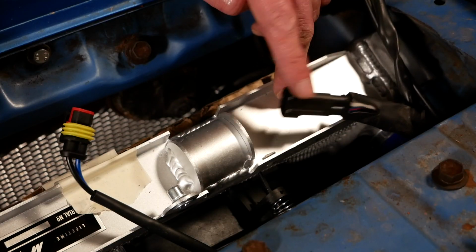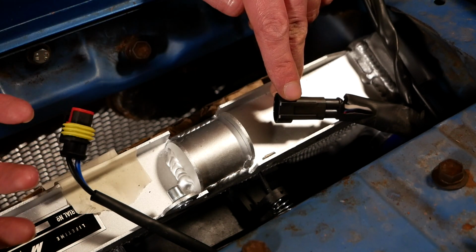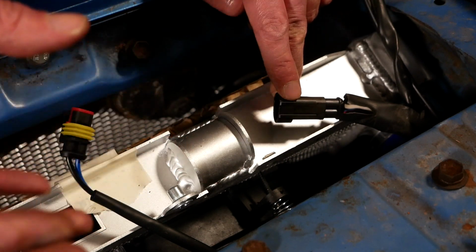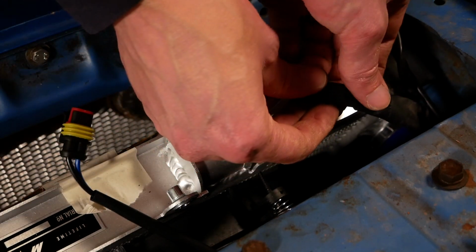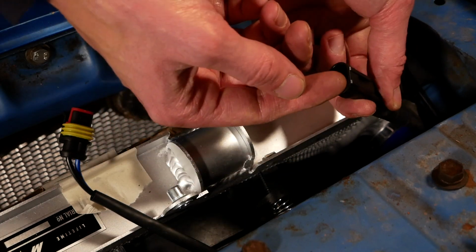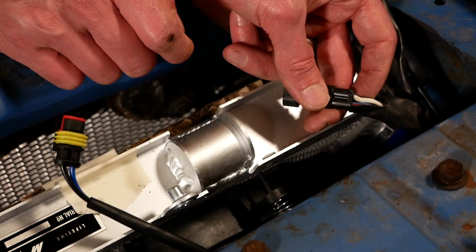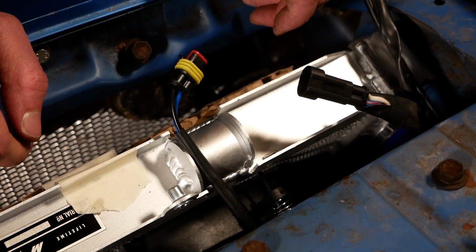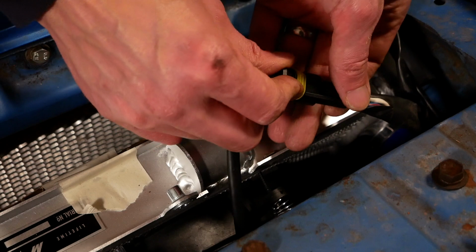So I finally got it in, but I haven't actually felt it click or heard it click, and I think the problem is I misunderstood the instructions when they talk about the wire size and what size plug to use. I assumed they meant wire gauge, but I think they're actually talking about the diameter of the wire including its sheathing. So I've used the red plugs, which go up to I think 2.5mm, which would have been fine by the gauge of the wire, but those are much wider than 2.5mm, so I'm struggling to fit it in. On the plus side, it's pretty well in there. I don't think it's going to rattle out. So as long as it makes a good connection, I'm going to leave it, but if I do find that it does work its way loose, then I'll replace it with the next size up.